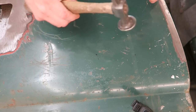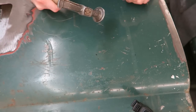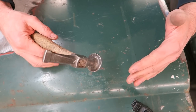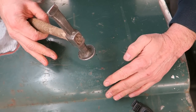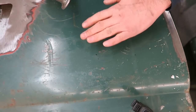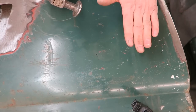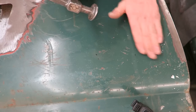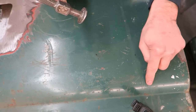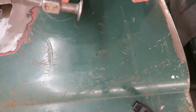And like I was saying about glancing the panel or skimming the panel, if you go in the direction of the dent, then you'll manipulate more of the damaged area back into the panel, and move the length then of the steel back into the damaged area, which is depressed. It's a shallow dent. You've lost your distance in there because you've gained it up here. You relieve your dent, you put some distance back into this area, and it pops back up.